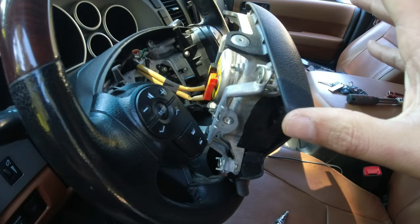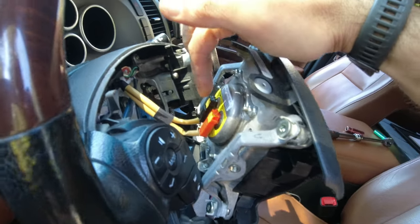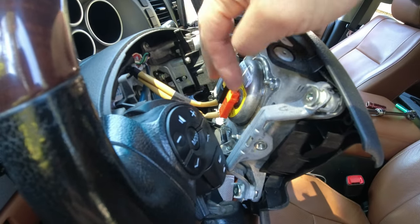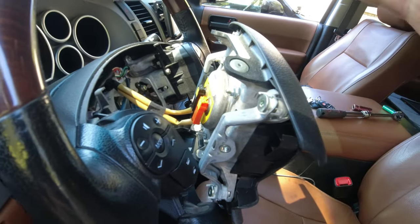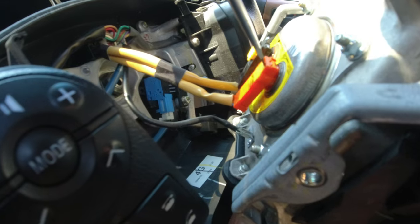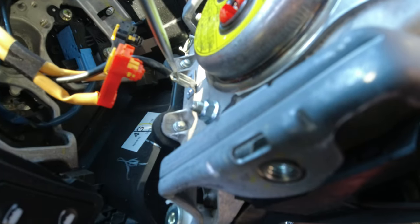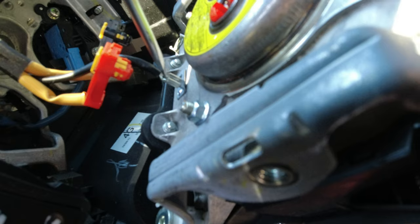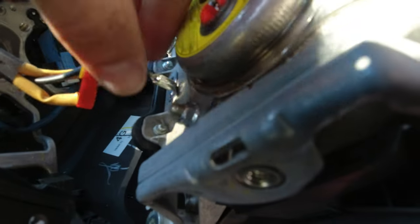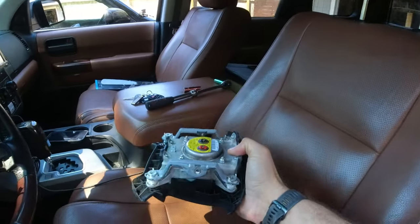She's out. We pulled the airbag forward. Safety equipment always has built-in redundancies — these things won't just pull off no matter what you do. There are releases on the back that you have to pull off with a flat head, which should allow this to wiggle out. Obviously this is positive and negative, and you don't want these to arc, so good thing you disconnected the battery. Once you pull that out you should be able to pull the airbag off completely. And then the last thing you have to remove is the horn button — there's a tab that holds it on, push down with your flat head and wiggle it off. The airbag itself is now off.